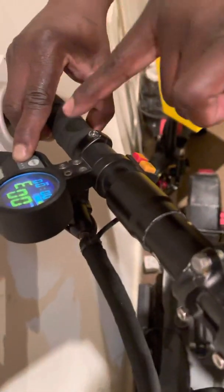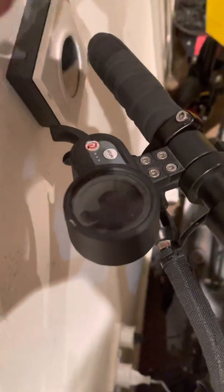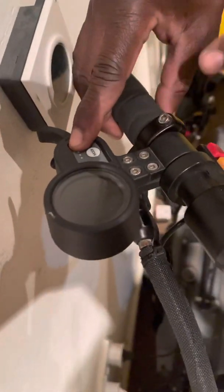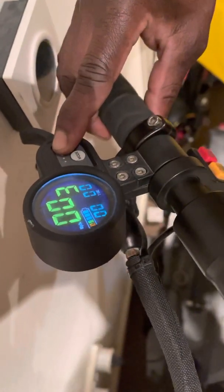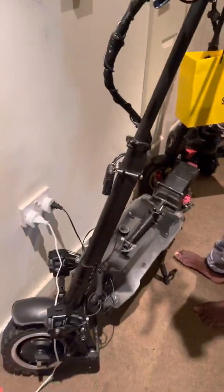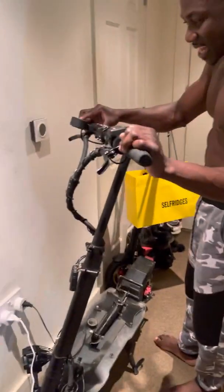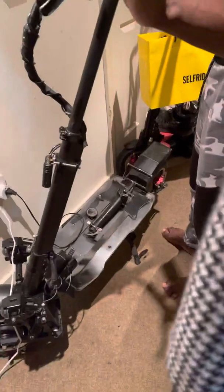If I leave my hand the scooter goes off, as before. So to test whether it's the controller or the accelerator, press it and keep your hand on it — don't let go. Once it's on, tilt the scooter so the rear wheel — the single drive motor — is not touching the floor, and you'll see that the scooter runs.